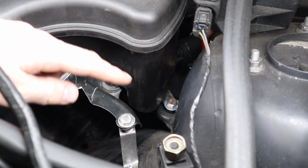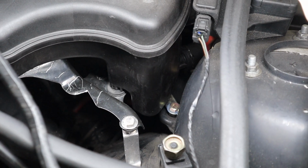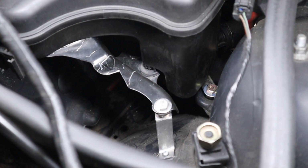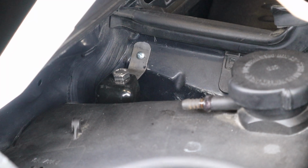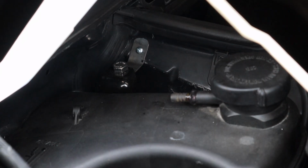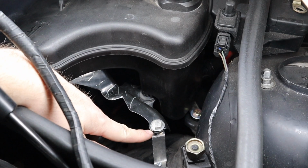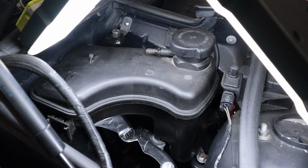Down there on the right-hand side, right there, there is a tab that's got a little piece of rubber on it. So this actually isn't solid. It actually flexes a little bit, just like it would originally. And then that piece of metal right there is hooked up, and then I've got a couple more in the back. There's that one straight back. Then there's an L bracket just behind here that helps hold this whole thing together. Most of these have rubber washers in between there. So underneath this, there's a rubber washer so it's not solid, and that's how I was able to mount this in there.